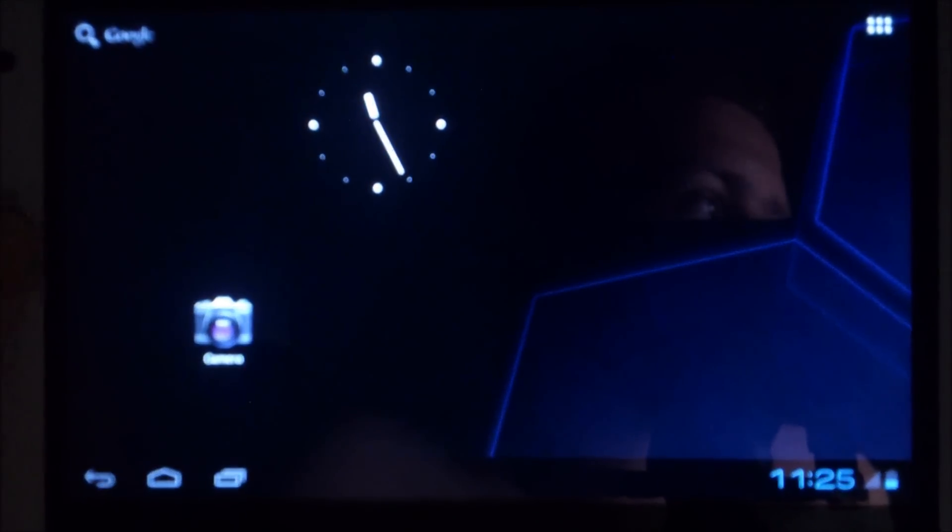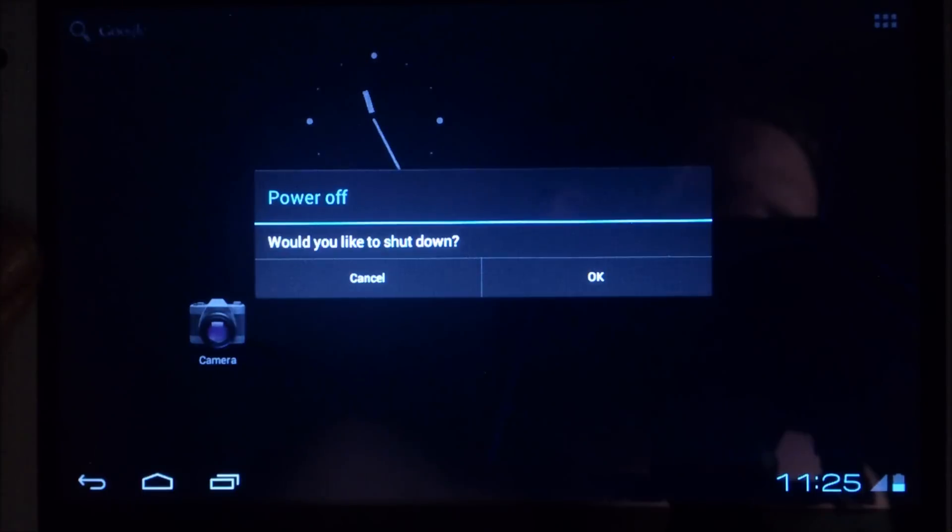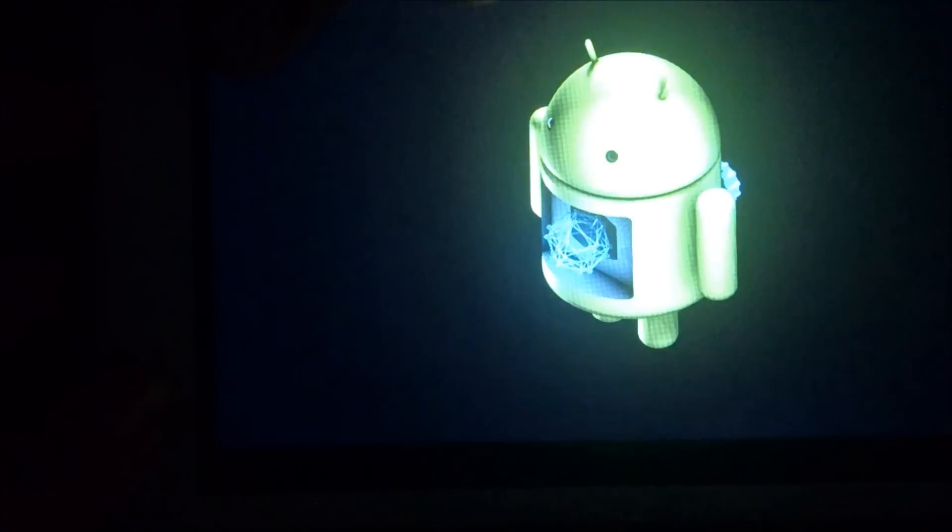What we want to do now is turn off the tablet again and shut it down. Now we did shut down the tablet and we are going to remove the SD card. We are going to boot it again — press the volume down button and the power button again. With no SD card installed, it is a mistake I made — it will just flash again. As you can see, you are now in the recovery menu.